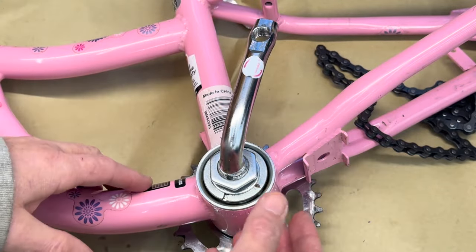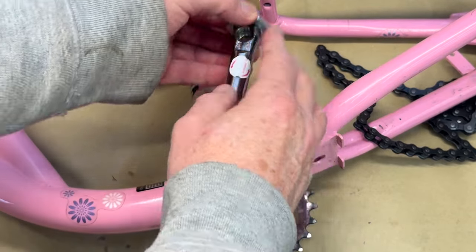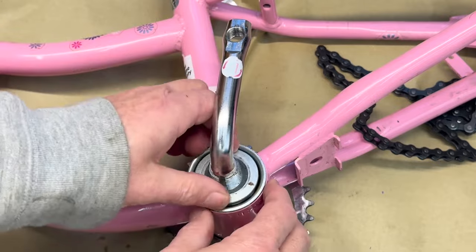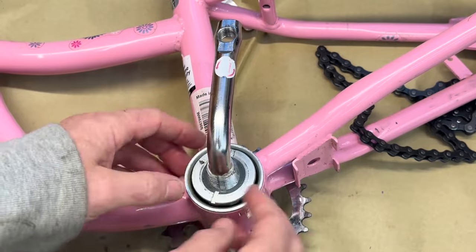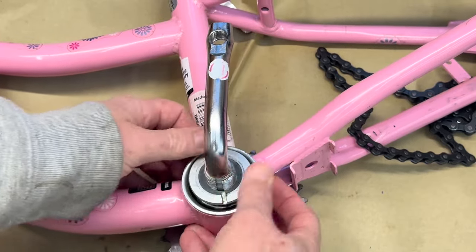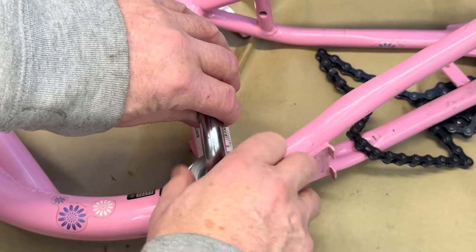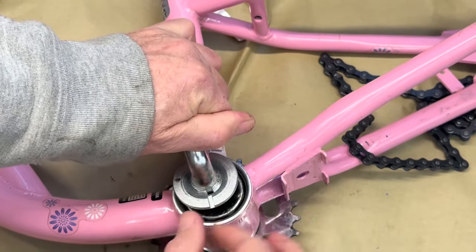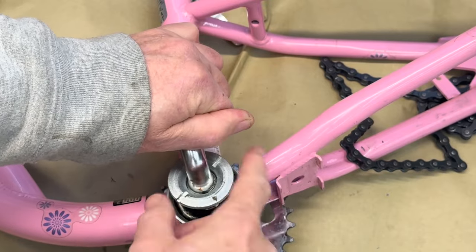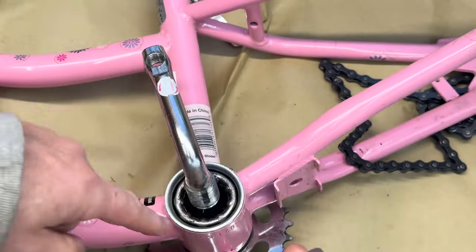To do that I'm going to have to cut it off. So I'm going to take out the bottom bracket of this little bicycle. These here are righty-loosey — take that off, and a washer. This part right here is what's going to be pressed against the bearings. There we go — that seals the bearings to this side of the bottom bracket. I'll get my pair of pliers, just pick them up and put them on.